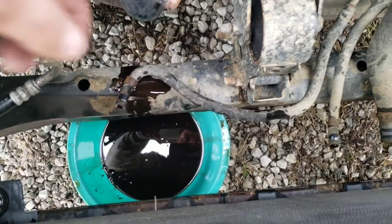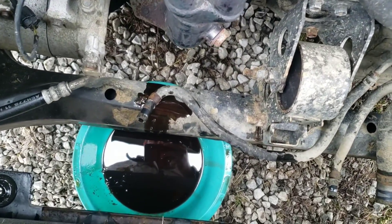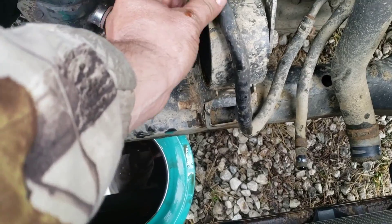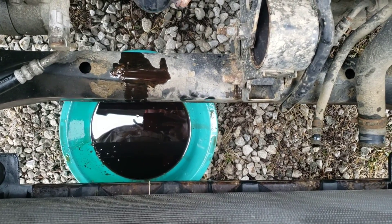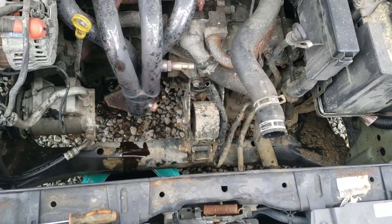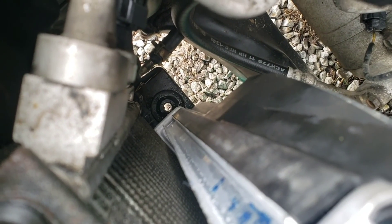We're still losing fluid. It would be best if you could tie this up to something. It's still leaking on me a little bit, but check your trans fluid when you're done. Tie that up on this O2 sensor so that way you don't lose fluid. Be careful to bend them too much though, especially if they're brittle — you don't want them to crack. If you lose very much fluid, definitely top it back off the amount that you lost. Don't use the dirty fluid. There are little pegs on the bottom — when you stick it back in, there are little holes there, you just stick the pegs back in.